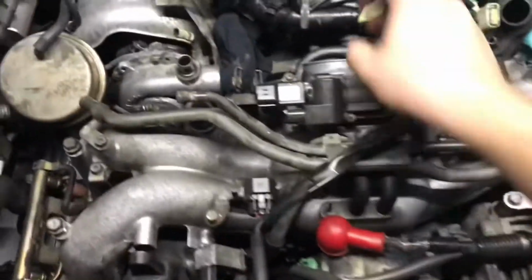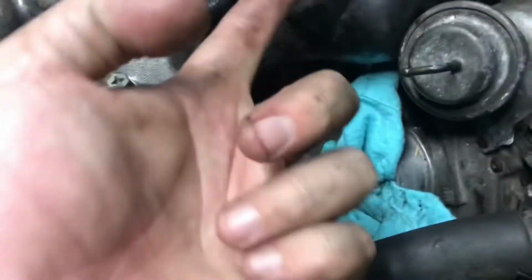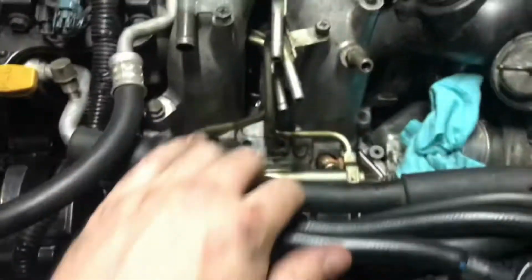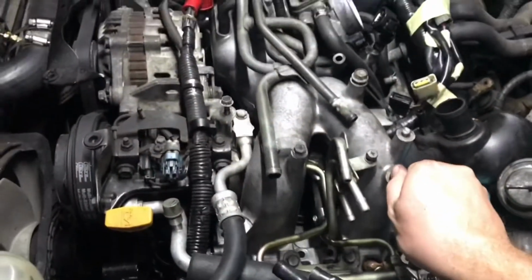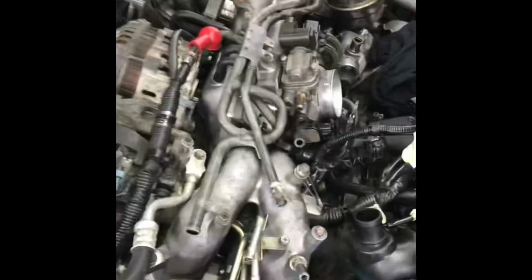All the inlet manifold bolts are officially removed. So this loom here is basically just that side there. I made room to access all of the bolts. The first thing I did, so I popped it off the mouth of the turbo, flexed it up so that I could access this hidden bolt here. But after WD-40ing them, basically the whole inlet manifold is loose, ready to come off, but there's some more hoses here that are connected to it, so I'll have to come back to that another day.